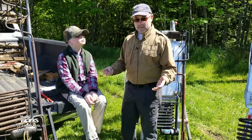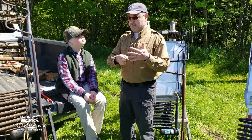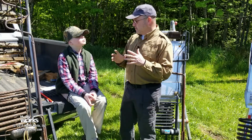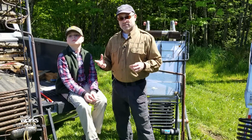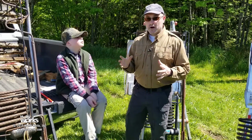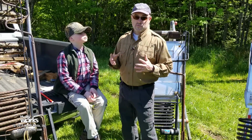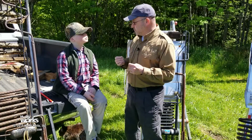Now, why ammonia? It turns out that the ensemble of ammonia, hydrogen, water, and sodium chromate are the absolute perfect cast for this performance. I'm trying to do a movie theme, okay? It's the most perfect cast for this. Why ammonia? Ammonia's vaporization properties are stellar, bar none. It is a wonderful element. When it vaporizes, it absorbs the heat around it. So for that reason alone, ammonia is a wonderful element to have in here. When it vaporizes, it absorbs heat, okay? So that's key.